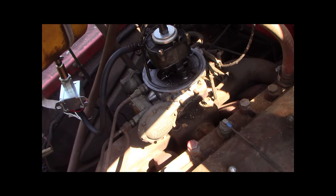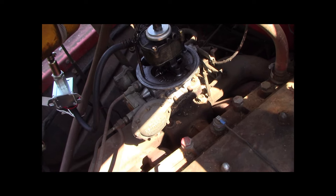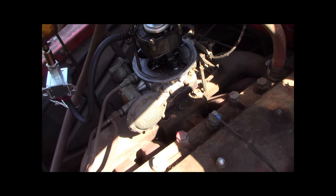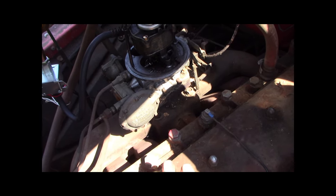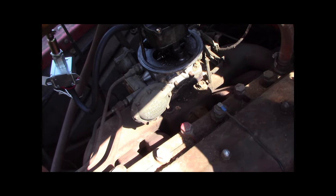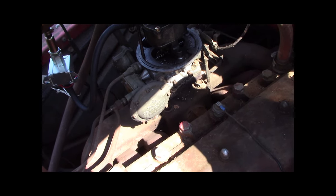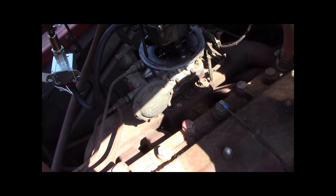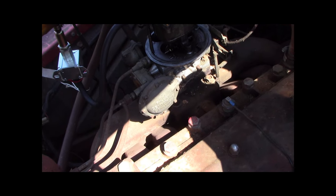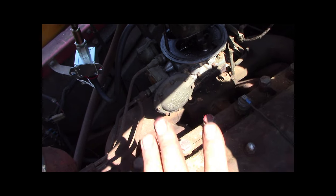And I've got another Holley, a regular modern 1970s Holley, off a 391 FE with a vacuum governor. And this is a square bore. This is a smaller pattern than a regular Holley. So I may be able to adapt the more modern Holley to this one off the 391 Ford motor and still connect up the governor, because I don't want to over rev this thing. So we'll see if I do that, or I got a spare one of these.